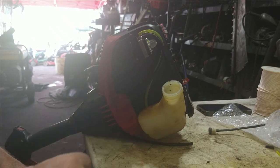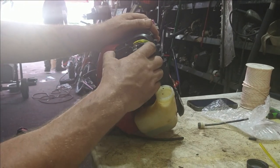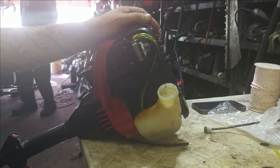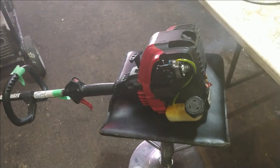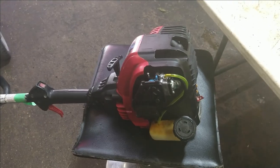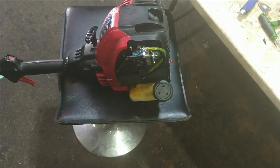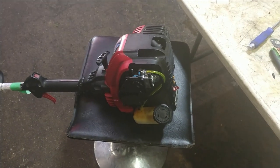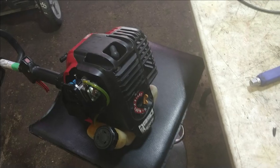That's pretty much that. We're going to go ahead and put some gas in this and prime it up to see that we've got the lines hooked up properly. It's priming — that's a good sign, primed right up. If it wasn't priming, you'd look in and see foam coming out of the fuel filter, meaning you've got the two lines backwards — just switch them. It's firing up and starting to idle. You may need to run it a little bit to get it running properly. There is an adjustment on the aftermarket carburetor — it's a flathead. Sometimes you have to turn it a little counterclockwise to make it not bog out when you squeeze the trigger. We also need to check the oil on it — I'm smelling a lot of oil.